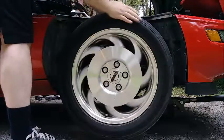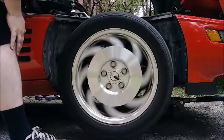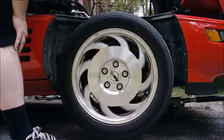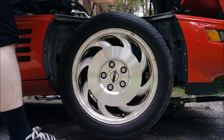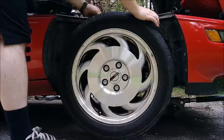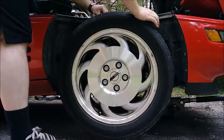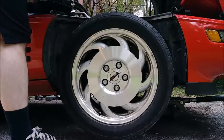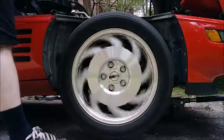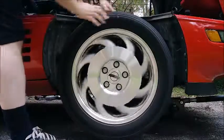Now when the wheel's moving forward and the brakes are not applied, we get this weird thumping noise. It's very rhythmic — it's long and drawn out when the wheel moves slowly, it's very fast and short when the wheel moves quickly. So depending on speed it changes the frequency and duration of that thumping noise. It doesn't do it when it goes backwards, it doesn't do it when you're applying the brakes, it does it when the wheel's moving forward.